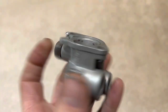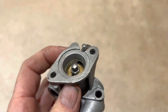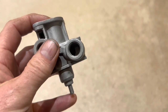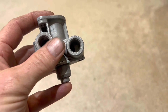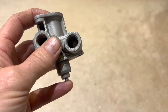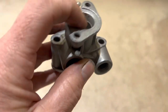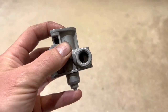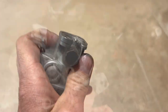The last adjustment you can make is via this bolt here — it should have a little cam on the end — which regulates how far this can actually travel up. The further this is up, the richer the car will run. So if you want your cold start to never be too rich, you can adjust that so that this piston cannot rise above a certain level when the car is cold, and that is then locked in place with this little screw here.